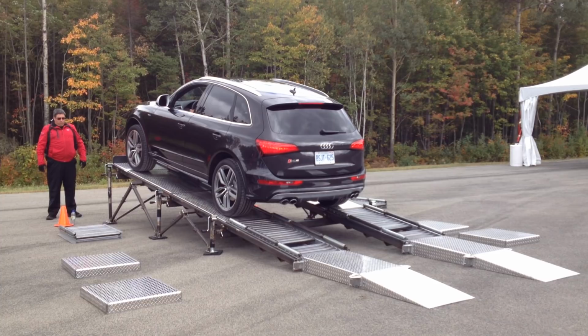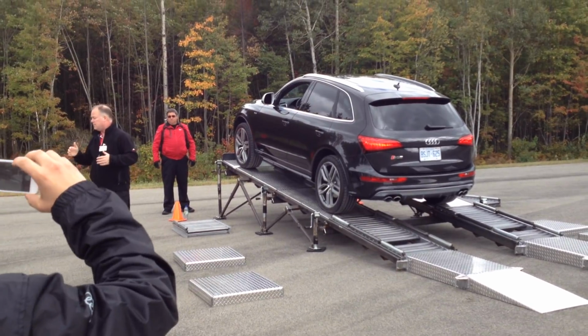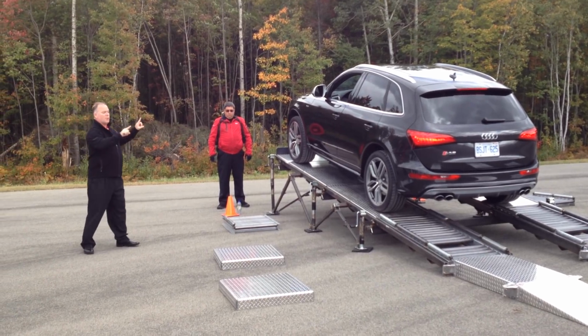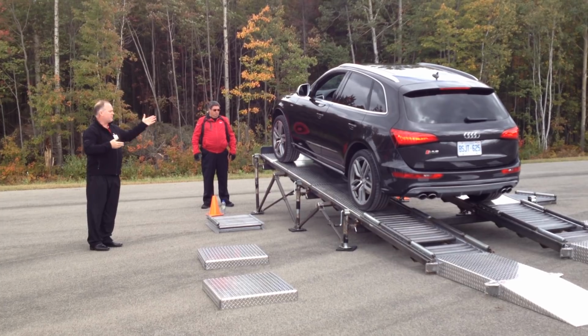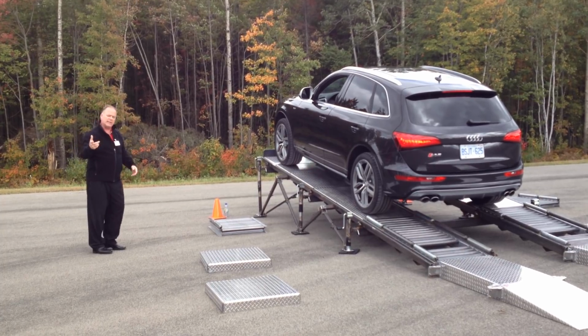So the mechanical center locking diff, is it effective? Absolutely. And you saw the rear wheel had to do 3-4 spins, and we got lock up and we started walking the vehicle up, front wheel drive. So from a north-south, easy to walk, right? It's 40-60, but easy to go up to 70-85, and we can play with that all day long. Now let's make it more challenging.